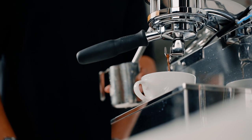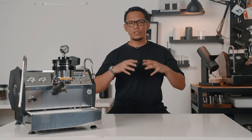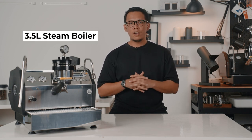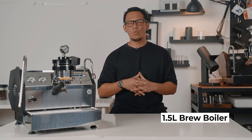The GS3 is the first La Marzocco home machine to feature a double boiler system, which means steaming and brewing back-to-back shots is a walk in the park. It also incorporates La Marzocco's popular saturated group head to ensure optimal heat distribution and temperature stability throughout the extraction process, resulting in consistent and precise shots. The steam boiler has a capacity of an astounding 3.5 liters while the brew boiler is at 1.5 liters. It is important to note that the GS3 takes up to 30 minutes to fully heat up from a cold start, simply because of the larger boilers.